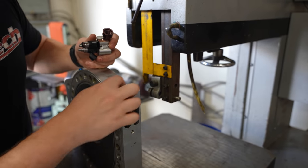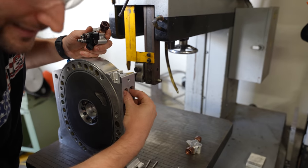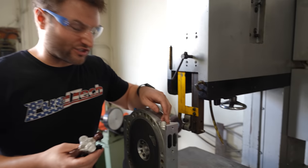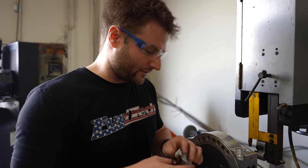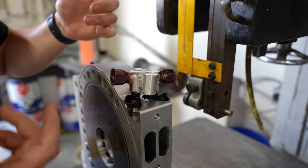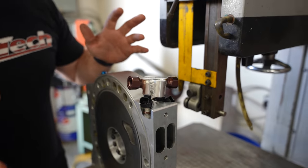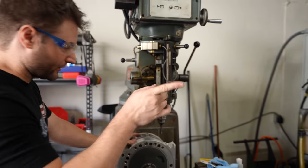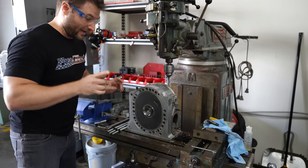Thankfully, this bolt already goes deep enough so when this does collide with it I can sink them perfectly. If you go too far with this one, you are now into the suck zone — the intake runners. This is such a very tight tolerance situation. Everything ends up working out perfectly. This is our test version, but they're overbuilt so we can run them. The manual mill, oddly enough, ended up being the better choice — it is almost barely not the choice.